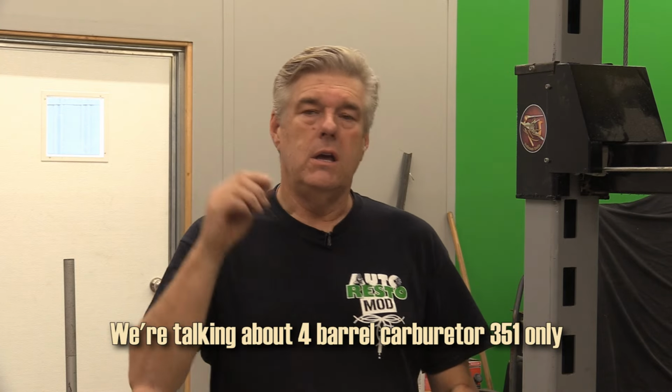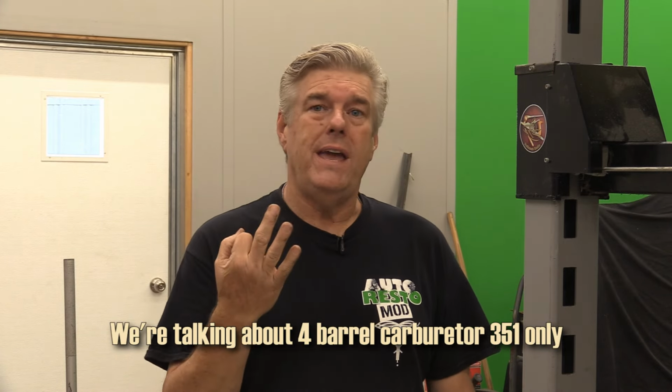All right, so while Cam is in here changing the oil on this, I'm going to go over a couple things about the 351 Cleveland and the 71 to 73 Mustang. Now, they had two 351s for this car. Initially, in 1971, they had three. They had the 351 4V, they had the 351 Boss, and they had the 351 Cobra Jet about mid-year. Now, the Cobra Jet's kind of interesting because unlike the 4V, it got some special parts pulled from the Boss 351 ranks. For instance, the bell housing on it is a cast iron bell housing.